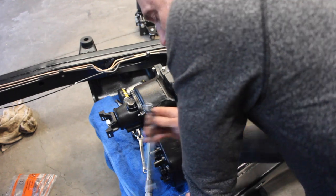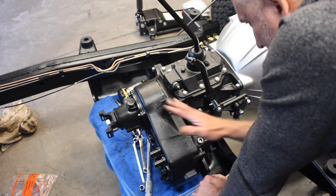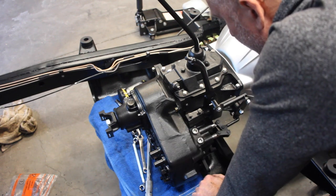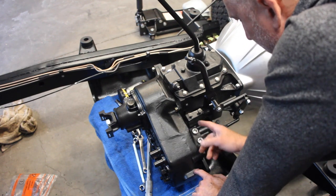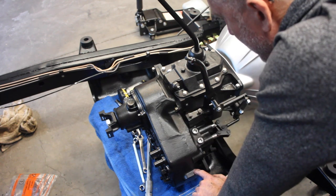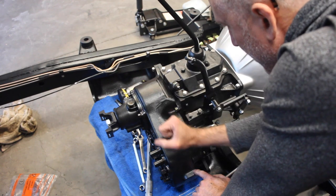That's as tight as I can get it — you win. Now that we've got all five bolts installed, as tight as we can get that one, and all the other bolts set to 30 foot-pounds, we've now installed our Dana 20 transfer case. Public service announcement.